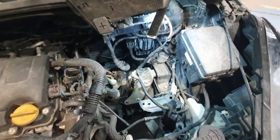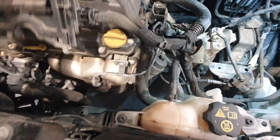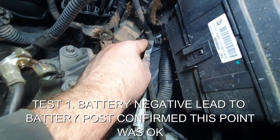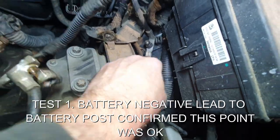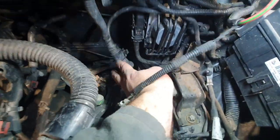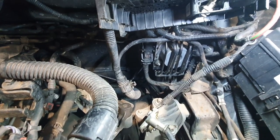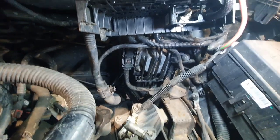We've got the battery and battery tray out and the ECU is just dangling on its harness. Here's the earth point — doesn't look very corroded to me, but I'll take it off, give it a good clean-up on both ends, clean the body side up. Then with this cable going into the harness I'll take it off at the starter motor as well and clean up that end, which is possibly where the fault may lie. Build it back up and let's see if we've got it fixed.